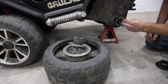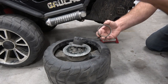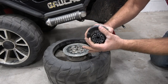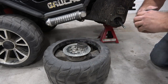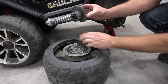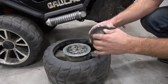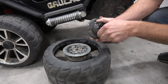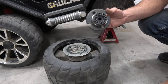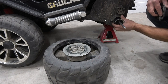Check this out — it's got roller needle bearings! Amazing. I took apart the old gen one Gaucho and all it has is basically a bushing. The needle roller bearings are obviously a big upgrade. I would suggest lubricating them with something like graphite or a dry lube — not WD-40 or anything like that. That is the one upgrade on the gen two. If those bushings in the gen one wear out it would cause wobble, so the needle bearings are the surprise upgrade I did not expect to see.